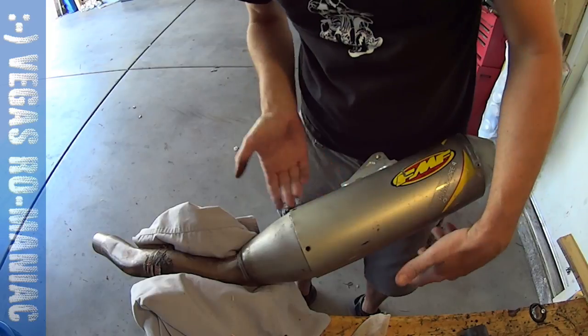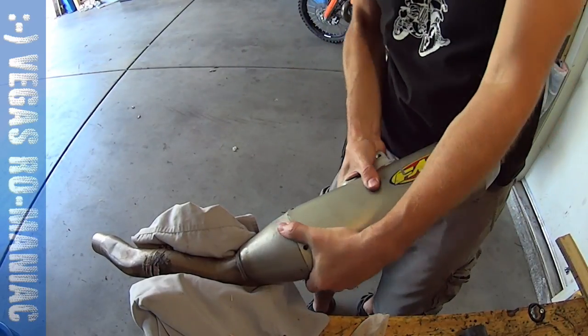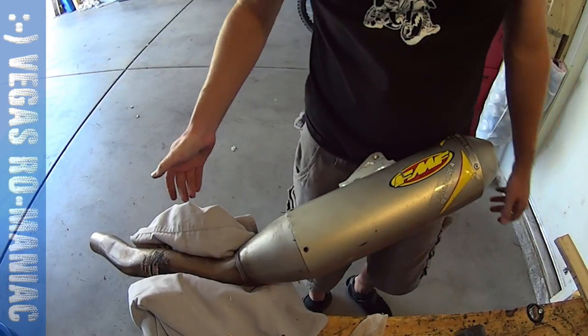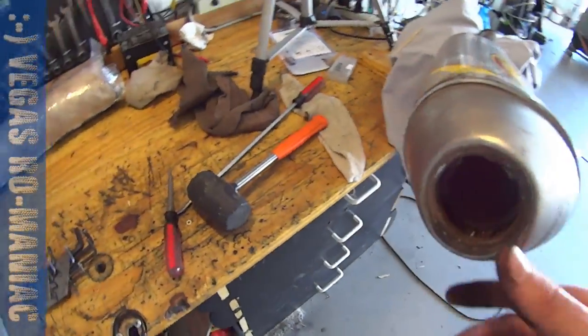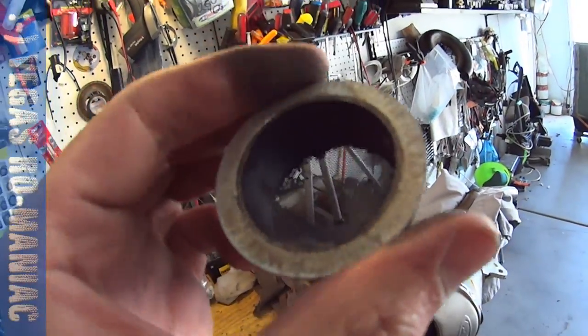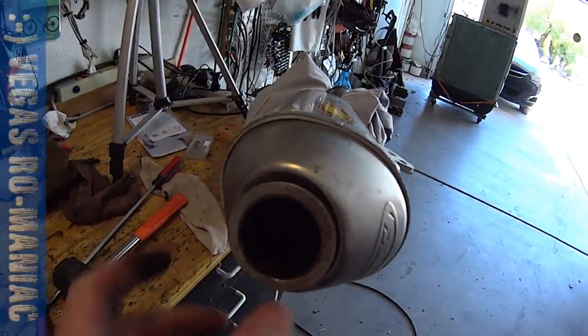So I got this far, but I put it in a vise and it's moving — turning left and right, but still not coming loose. Well, it's out. And it's out only because nobody told me I have to remove the freaking spark arrester. Every video I saw online never mentioned anything about the freaking spark arrester.